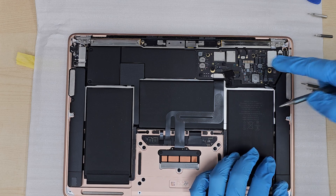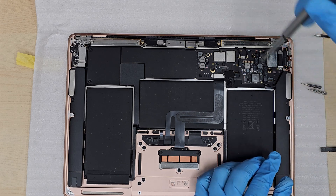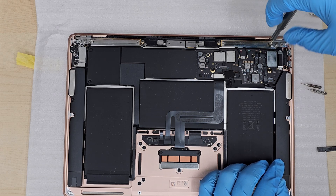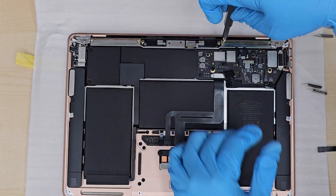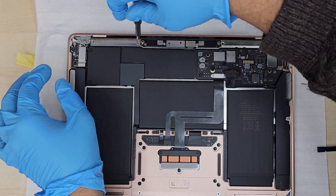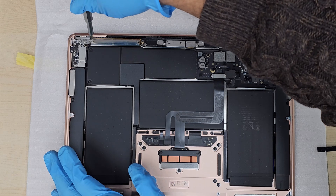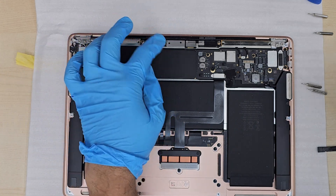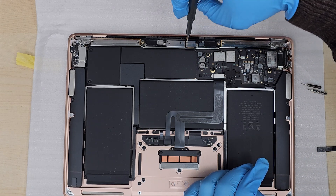If you ask me what is the most difficult part of this replacement, I would say removing the Wi-Fi antenna — it comes with such a long bar and pulling it out is not easy. It takes a little bit of time, so check the video carefully and you'll be able to do it. The antenna is secured with four screws on this model, so keep those organized. Then disconnect the LCD connector, take out all the screws, and lastly remove the six screws from the hinges — those are quite big and stiff, so make sure you use the right tool provided.